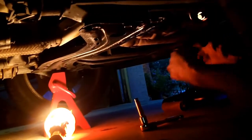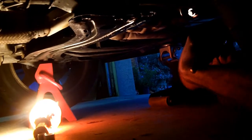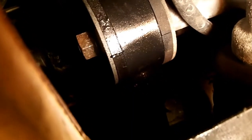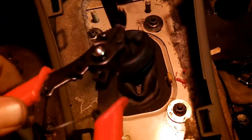Unfortunately there is just not enough room for me, the camera, and Andy to get all under there so I can record this for you guys. So what he's doing now is removing the bolt from the shift linkage on the transmission side. That one also just has one bolt, and there are going to be two big washers that drop down when you loosen that one. So I'm coming in from the front of the car and trying to loosen that bolt. I used a breaker bar with a 14mm socket, and once I got that one loose I used a 14mm wrench.